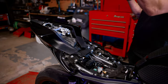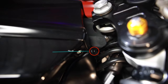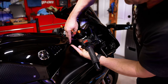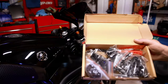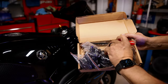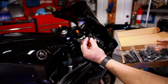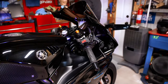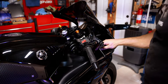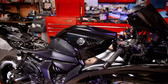Our seat will just come right off. We have three push pins in here we need to get out. Something I keep forgetting to mention — these do break. Getting replacement pieces is not that hard; I've found them on Amazon and I'll put a link in the description. I got this little kit that comes with a removal tool. The packets we need will replace pretty much every push pin fastener on the bike. I'll link that below. There's a four millimeter here as well.